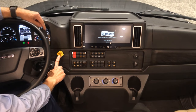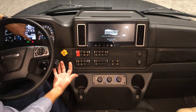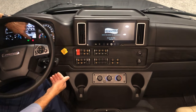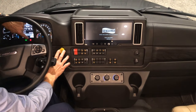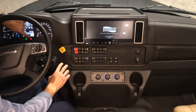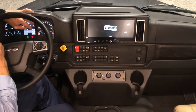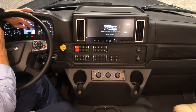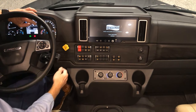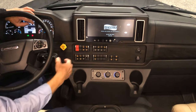The parking brake indicator, which is red, is illuminated meaning the parking brake has been applied. If I want to disengage the parking brake to drive or go in reverse I would press this forward — I'm not going to press it because we're parked inside a building. When I come to a point where I need to park the coach again I need to stop, apply the brake here to stop, pull this up — parking brake towards me — and then put the coach in neutral.